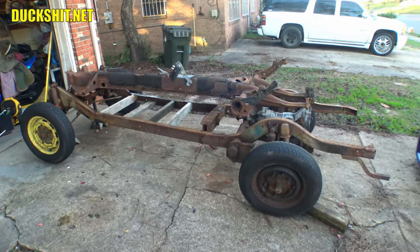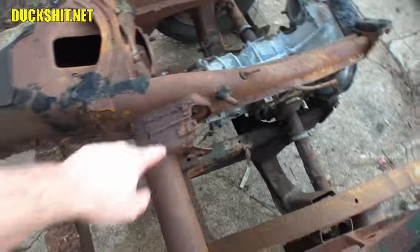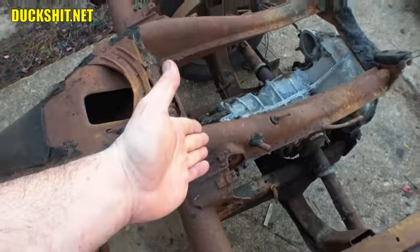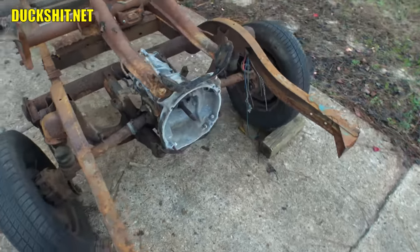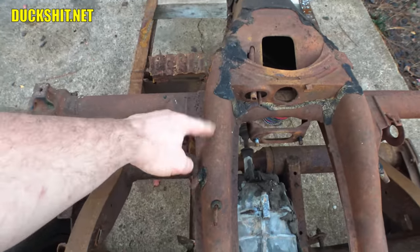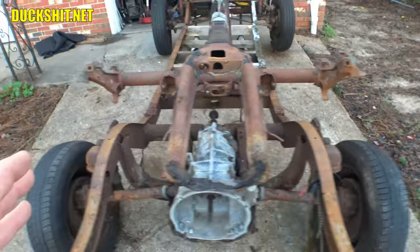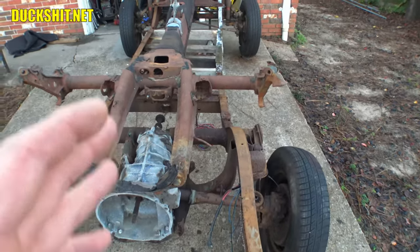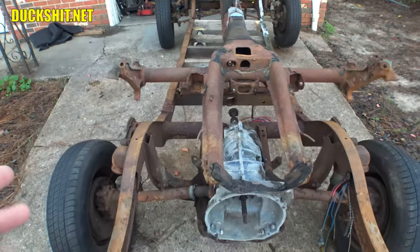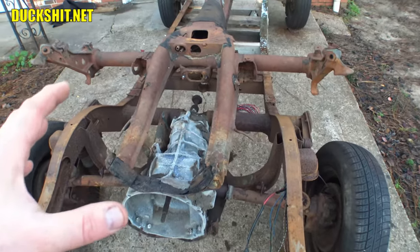It's pretty tremendous to see that this probably won't be all that much work. I'd have to do a little clearancing back here, and the frame horns have got to come off — I don't need them at all because the engine mount's going to stay on the bus chassis. There is IRS stuff right here — I can clip that out and graft it down onto the bus chassis. It's nice seeing these two on top of each other because now I can compare measurements. And one of the things is that the bus chassis is wider than the Beetle — about two and a half inches wider when measuring from the outside of the spring plates on both sides.